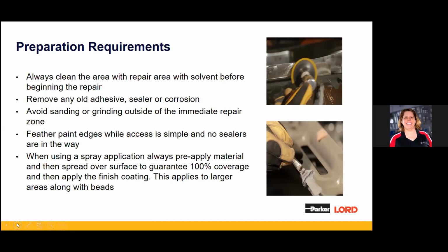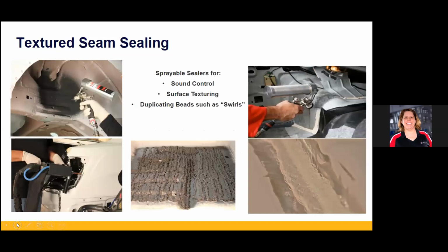Yeah, it ensures it, right? I know you and I have talked about this. Absolutely, we have. It's critical, right? If it's just the seam seal or just the color, and there's nothing else, we don't need to paint it there. We can't give it any opportunity for corrosion to sneak in there. Yeah, and Kristen will chime in later on when we do some chit chat. If you're uncomfortable with that, then prime it, and then put your texturing on. That's perfectly acceptable, and it's what I would personally consider the best way to do it.